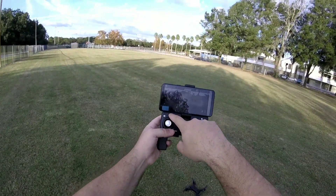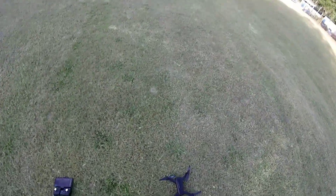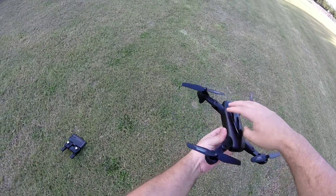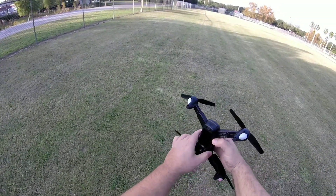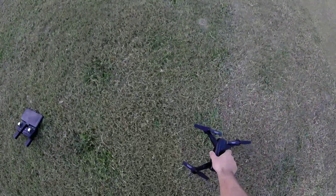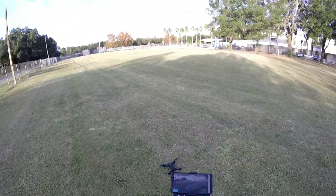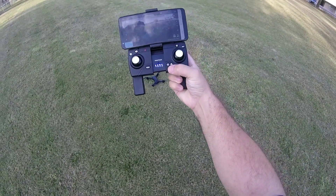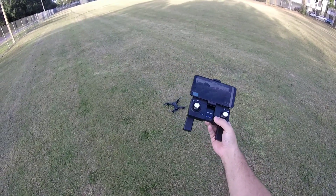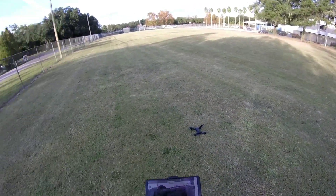To calibrate, hold the compass button down — it's ready for calibration. I'll grab the drone and turn it counter-clockwise, then tip it and wait for the lights to turn green. There they are, blinking to let me know it's done. Now for the gyro calibration — I'll hold the compass button at the bottom again. Done. Good to go.